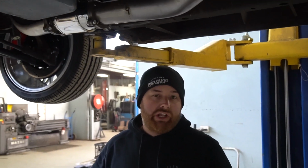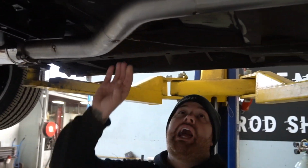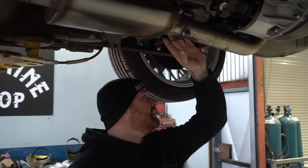Alright, so Griffo's tacked up the exhaust on the car. It's only going to be a one-off system for this car due to the fact that it runs a different exhaust manifold to what a standard one is, so it depends on what you're going to run, so we can't really do a production style of thing. So he's got 3-inch dump pipe into the converter, then he's put a hanger back here into the muffler on it. There's another 2 hangers here and it goes out the back.